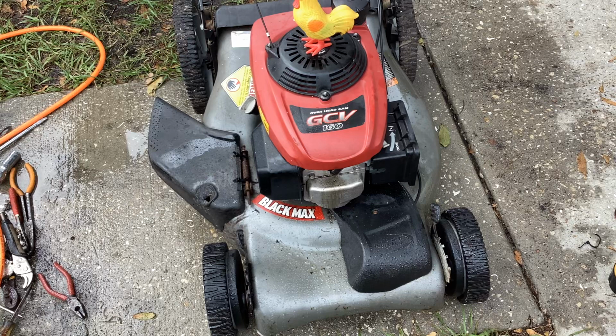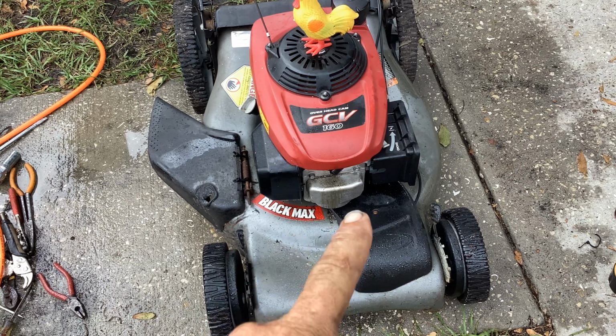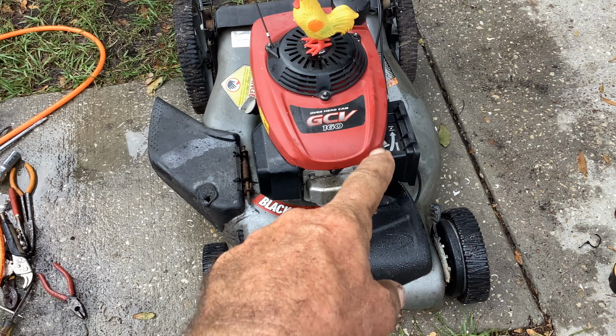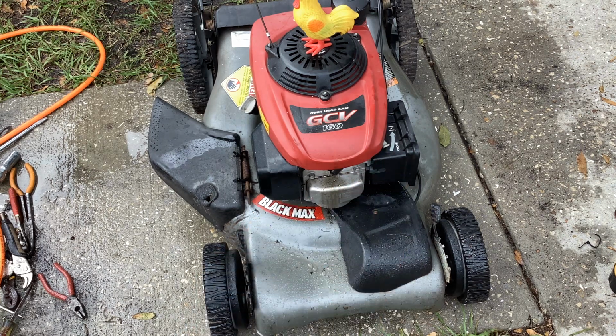Thanks for coming out. So this was a $20 unit. I got this in a package deal, 2 for $30. I gave 10 for another Honda machine that was rusted through. We tried to start this thing initially, nothing. I changed the safety brake cable because it was not pulling tight enough to let go of the choke, and probably not activating the micro switch for the coil. So we messed with that.